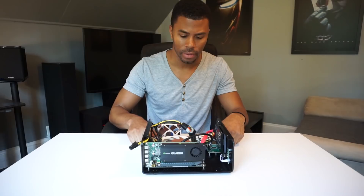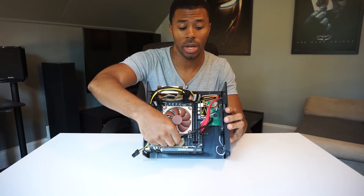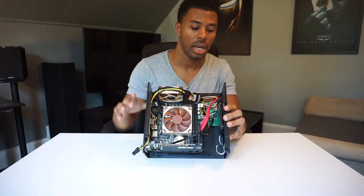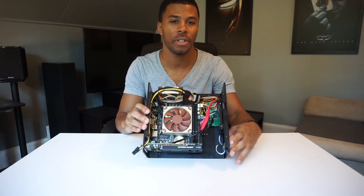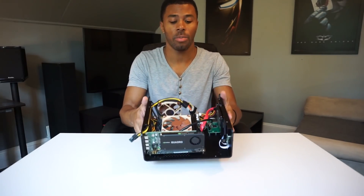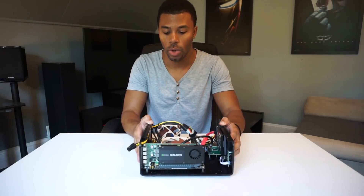The CPU cooler is the same. I did replace an 18 or 21-inch USB 2 cable that was super long and taking up space with a nice 8-inch one. And with 6-inch SATA cables, they're almost the perfect length — much better than the old 12-inch cables that come standard with most motherboards. When you're building a system like this, you should plan every inch. I learned after the first build what works and what doesn't.